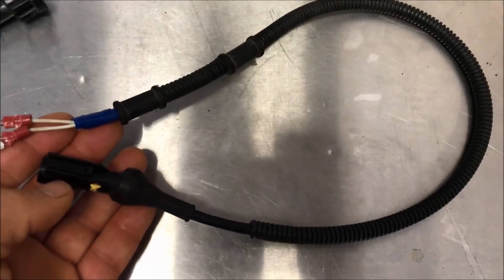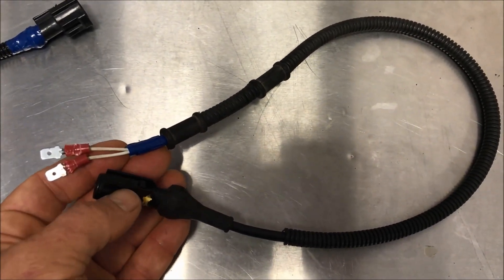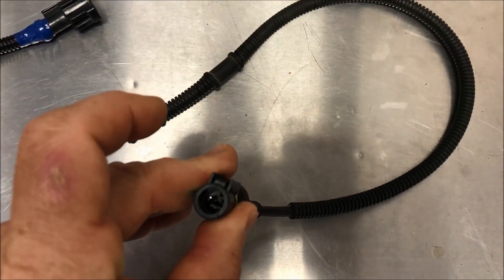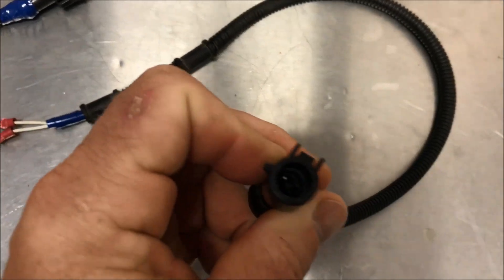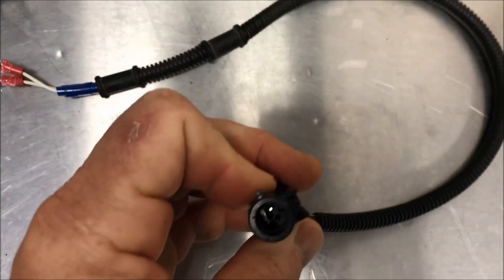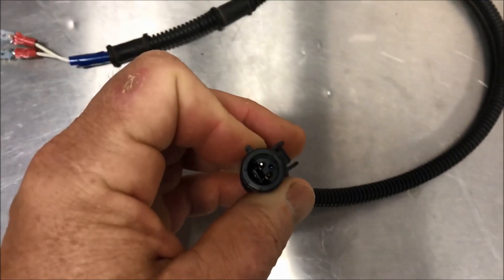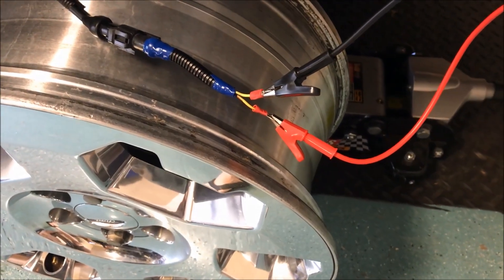This end I'm not sure I'm going to check here, but at least it will go to the ABS pump with the ABS system. This side plugs in — you can see it makes it a lot easier to plug this in and use your multimeter versus trying to feed probes into the connector to get any kind of voltage or resistance readings.